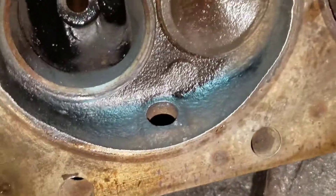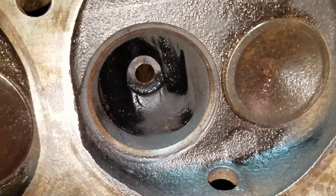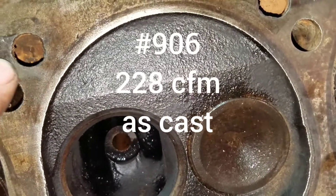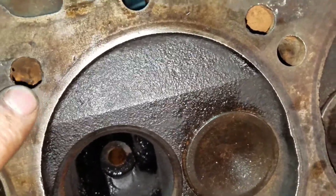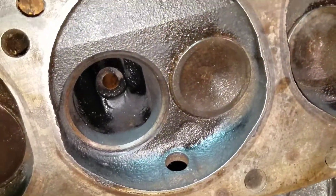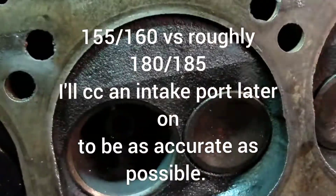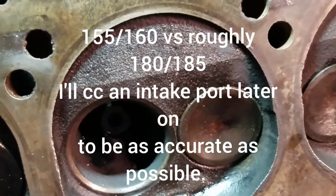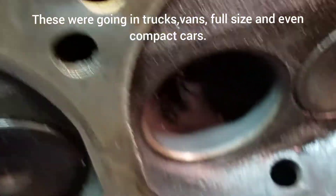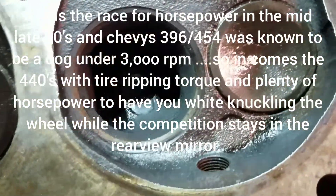The 202 heads are considered the performance head, and your 906 standard 208 intake / 174 exhaust big block head - the last set I flowed that I got the 280 from, when I put it on the bench it flowed 228 CFM. When I put a set of J heads over there that are bone stock - stock 202 J head from 1970 - it flows about 228 as well. The only difference is the port volume. The point is velocity. They're passenger car engines and Chrysler was thinking to keep it small and just keep the horsepower there - in other words, keep the flow number up.